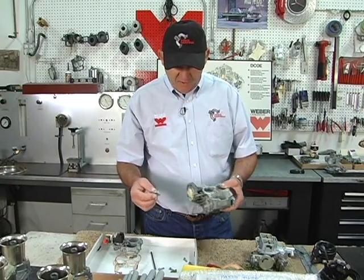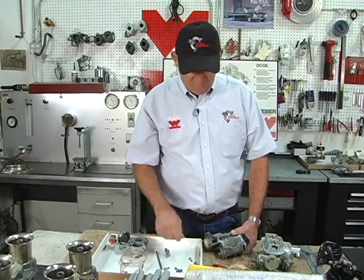One hint that we found, especially with today's gas prices, people are driving their cars, they've driven them for years, the way they got the carburetor out of the box, they're running a 140 main jet. Car runs fine. The question is, if they drop to a 135 main jet, would the car still run fine? And if it does, for the cost of a $4 jet, they've just picked up 3 miles to the gallon. It's not a bad idea to spend some time and dial your car in. The payoff can be tremendous.